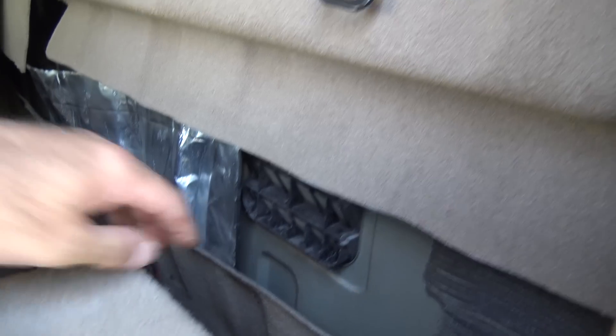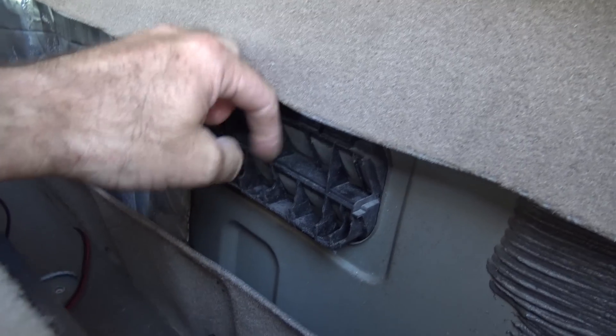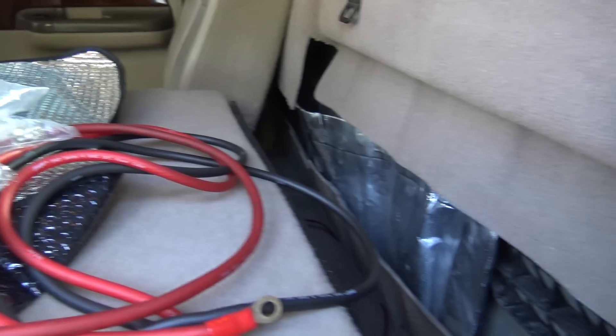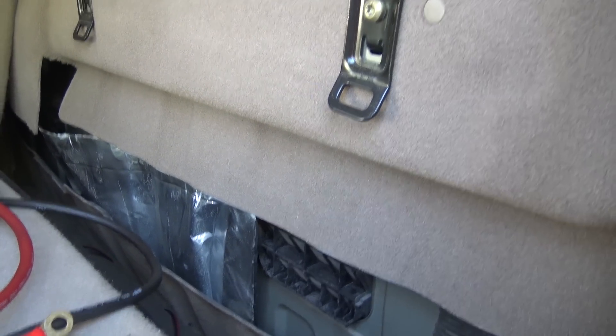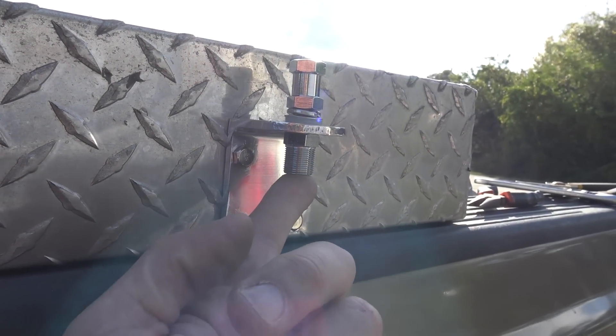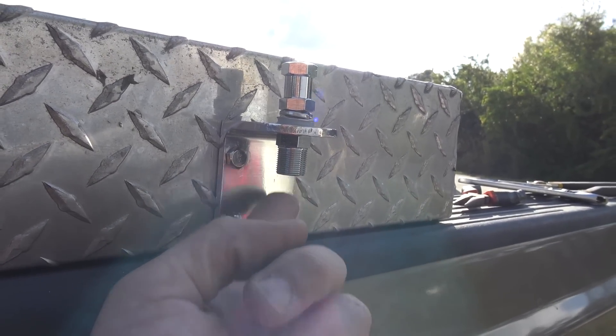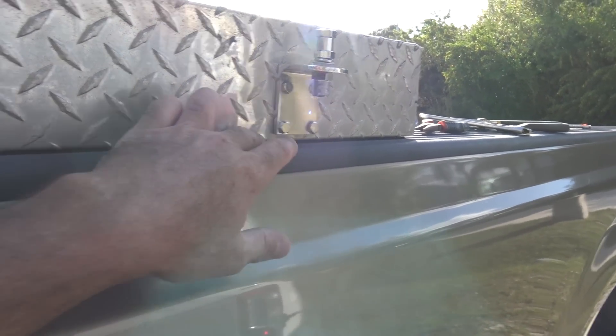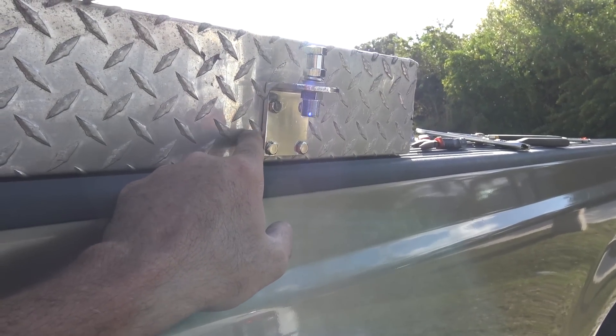There's a little passthrough here — it's supposed to be like this, a little flap — so I don't even have to drill a hole, I just pop it right through there. Then that's going to come up and I'll run coax up to the back of the radio. When the seat's up, no one will even see it. I'm going to run the cable from the phasing harness, tuck it right along here — it's not going to be hanging — and work it into position from there.